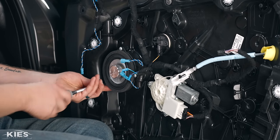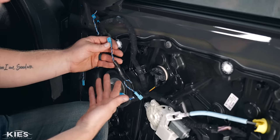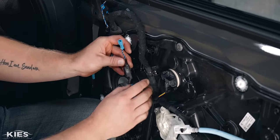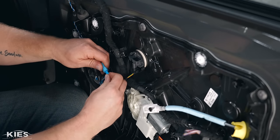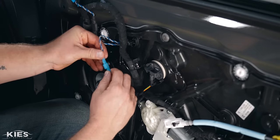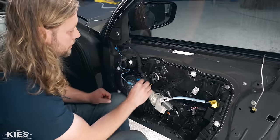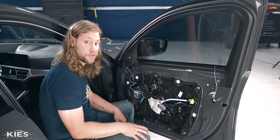Get one screw in to hold it and start reinstalling the screws — just make sure you don't go too tight, just snug it up, you don't want to crack the plastic. Looking at the new Beamer Tech wiring harness: the connection up top is for the input, and the wire that hangs down is for the tweeter. Plug the tweeter wire in and then plug the input up top. It's all labeled if there's any confusion. Now I'm going to zip tie and tape everything up to keep it nice and neat so there are no rattles inside the door.